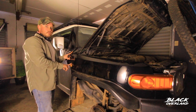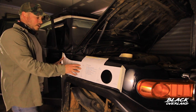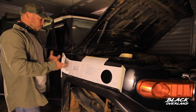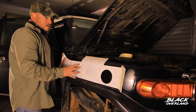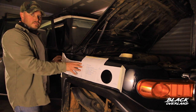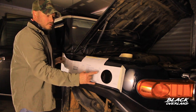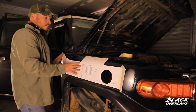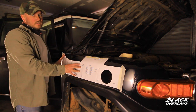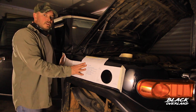Just take the globe out and leave the cable loose hanging behind you. I put the template on, but it comes from the manufacturer all rolled up and crumpled, so it's a bit difficult to lay it completely flat. What I'm going to do is put the nuts into the snorkel and then line it up here to see if the holes I'm about to drill are in fact in the correct place. Rather measure twice, then measure three times, and cut once — because once you've drilled in here and there's a problem, that's it, there's no going back.